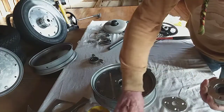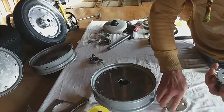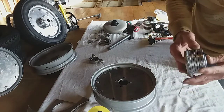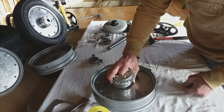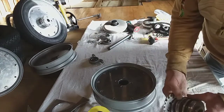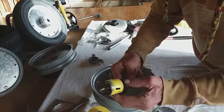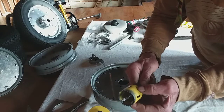And then the sprocket goes on, and then that bolts through for your wheel. This size - this one is inch and three quarter, 44mm. Now these are 45mm, so you need to try to take half a millimetre out with the flap disc.